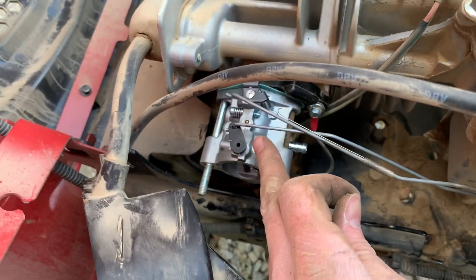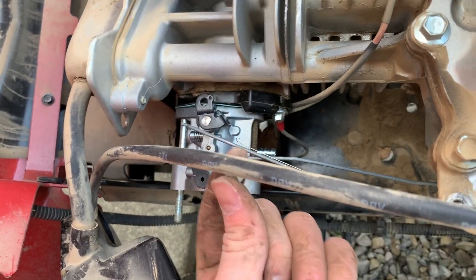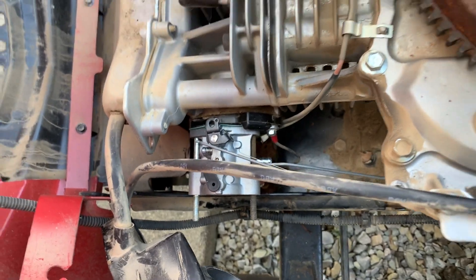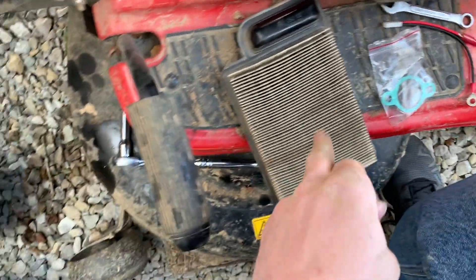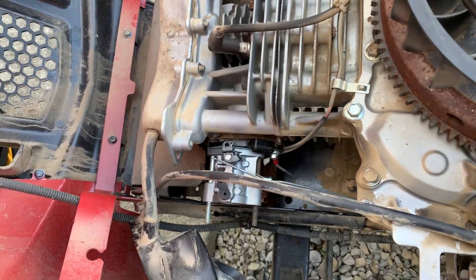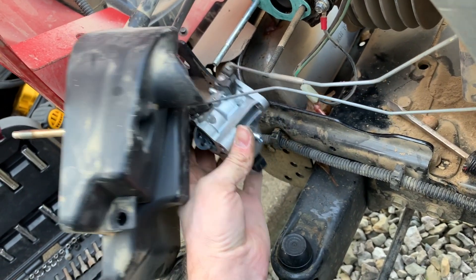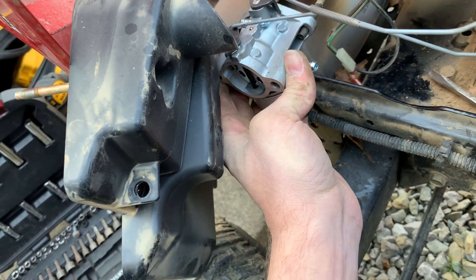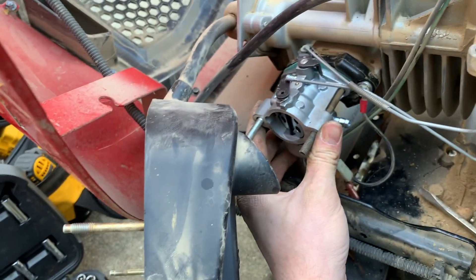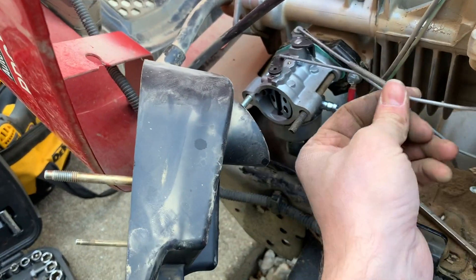I got that rod back in. I pulled the white thing off the top of the old carb to make sure it seats in that hole properly - it caused it to click in. I'll connect that spring, tighten everything back down, and make sure I put the gasket on the other side between the carb and the air box. Put the fuel line back on. This really wasn't bad - just try not to take that black thing off, that was my biggest hiccup. Pro tip: these rods are a lot easier to get on if you bend the carb around them instead of bending them around the carb. I popped that plastic thing back in the hole so everything should be good to go.